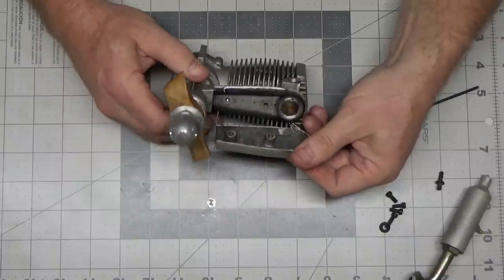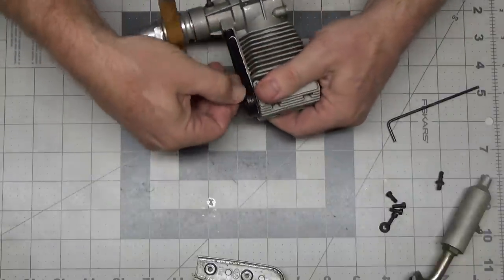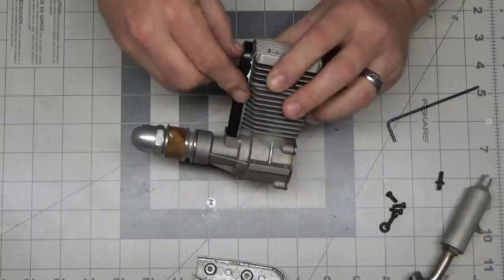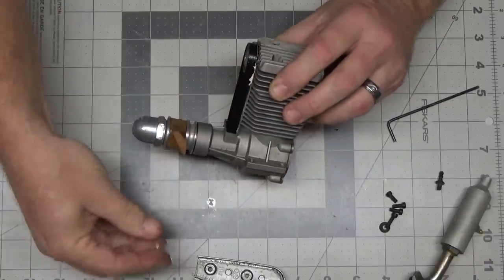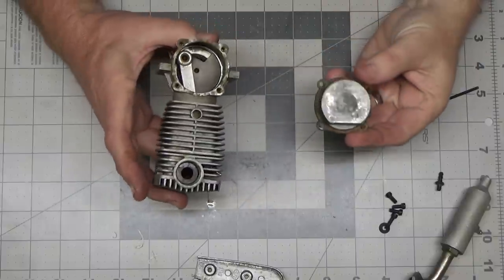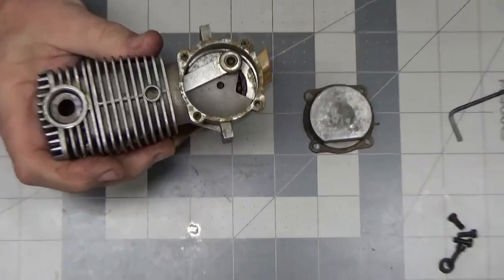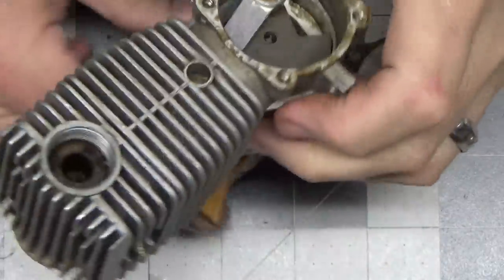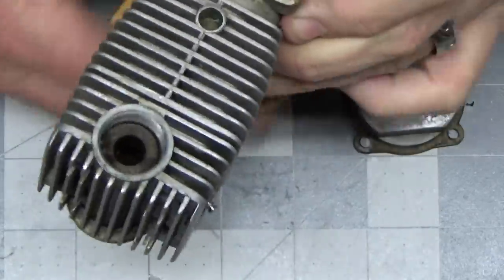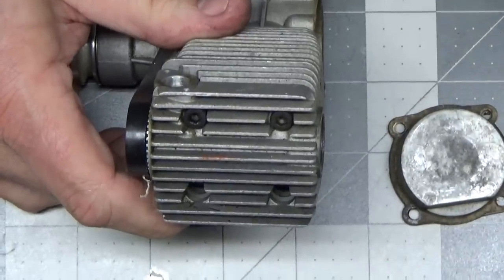There was the original sealant on this. Belt looks pliable and it's got a little moisture on there, which is a good thing. I learned from my last Webra that this sealant is normal and from the factory. That didn't take but a light little wrap with the mallet. There's a lot of gasket material there. Let's zoom in and take a look — I may end up having to replace these bearings. I mean, they don't feel bad, but they look kind of nasty.